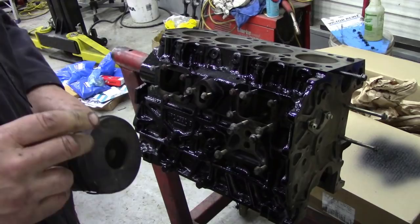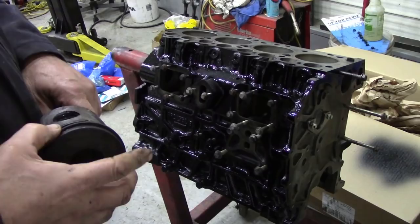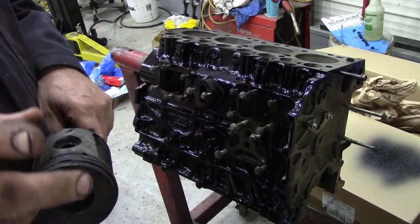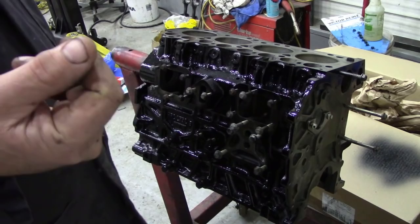The next thing is to clean up the pistons. I'm going to do it in a way that's frowned upon but practical - I'm going to use oven cleaner, my old favourite, because it's non-destructive and it can get right inside the groove. It doesn't scratch, which is really nice. But you've got to wear gloves and goggles because oven cleaner is nasty stuff - it's caustic and it makes your hands go all funny because it eats the grease in your hands.